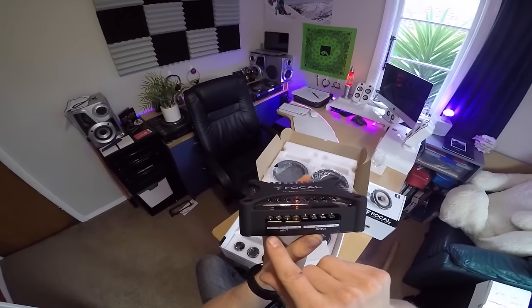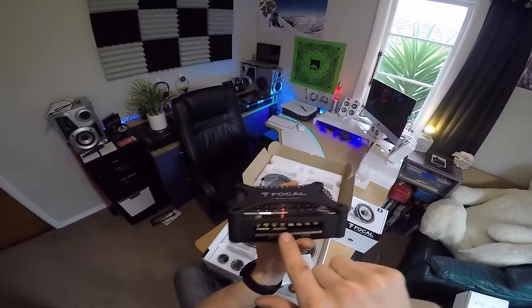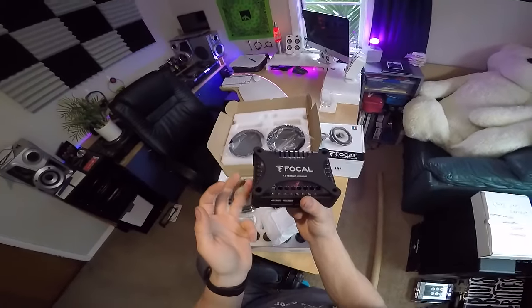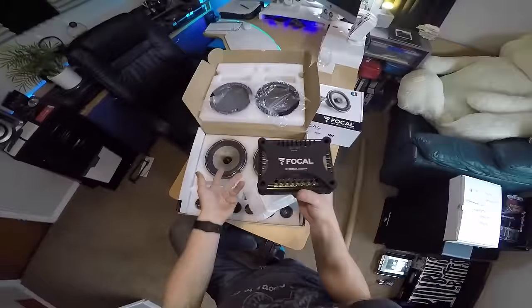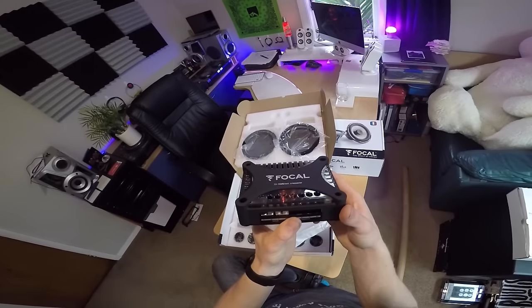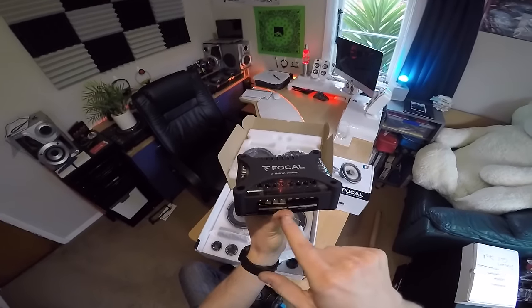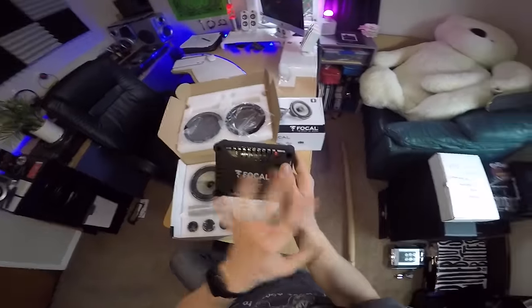On the front here we've got two inputs and two outputs — tweeter negative, woofer negative, tweeter positive, woofer positive inputs — and then tweeter and woofer outputs on the right-hand side. The reason they have two inputs is because they've made it so that you can actually bi-amp these speakers, using a channel for the tweeter out of an amplifier and a channel for the woofer. If you don't have a processor in your car to set the crossovers accurately, you can still use this passive crossover in-line to do that work for you. That basically means you can put more power into each individual tweeter and woofer but still use the passive crossover to protect the tweeter from doing bass and prevent the woofer from doing unnecessary treble. The way they have it set up at the moment, there are these little U-bends of metal going from the tweeter side to the woofer side on the negative and positives — that's because when you're not bi-amping, you want those to be linked. But if you are bi-amping, you simply take those U-metal bits out and put separate channels into them.